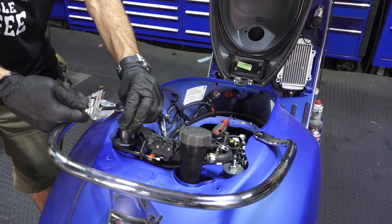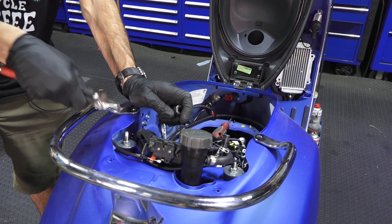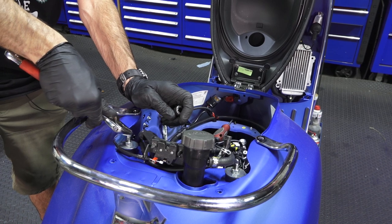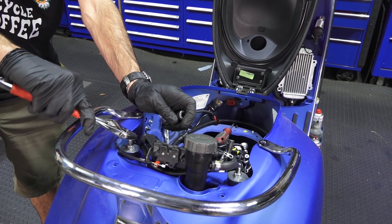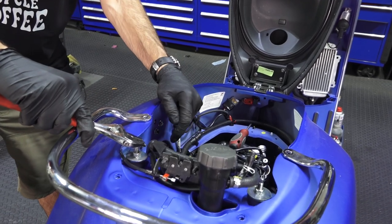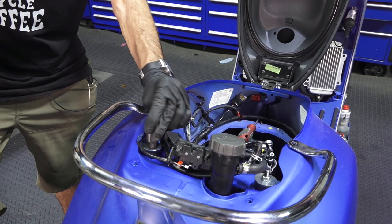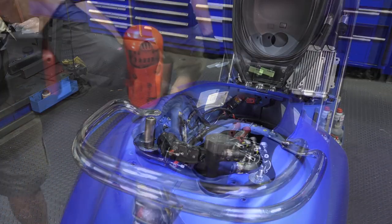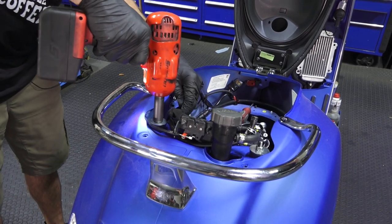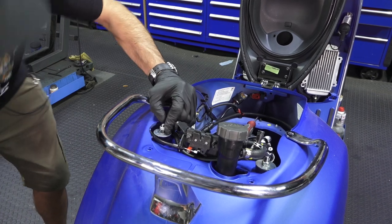You can see the upper shock shafts and rubber buffers. To remove the nut, if you just go in with a socket it's probably not going to work — it will just spin the shaft. So if you don't have a power tool like an impact, you can grab the flat on the top of the shock shaft and get a combination wrench underneath it. We'll just cheat a little and use an impact wrench with a 13mm socket to zip it off.